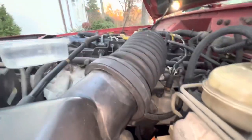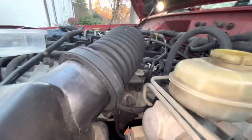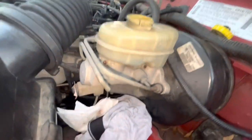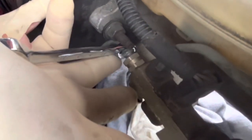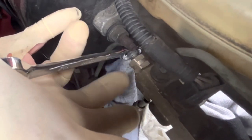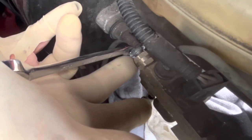What I've got to do is get this front one off — this front line on the proportioning valve. The front line is the one that goes to the front brakes, so I'm going to get that off and replace that line. Getting this front brake line off the proportioning valve and it's turning this thing too, so that may have to come back off and go back in.